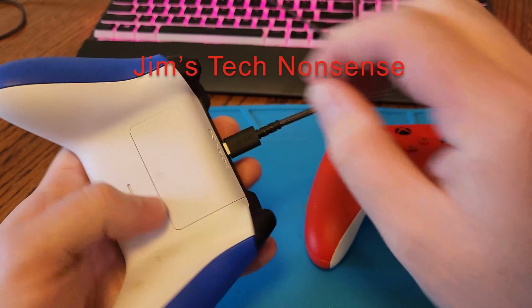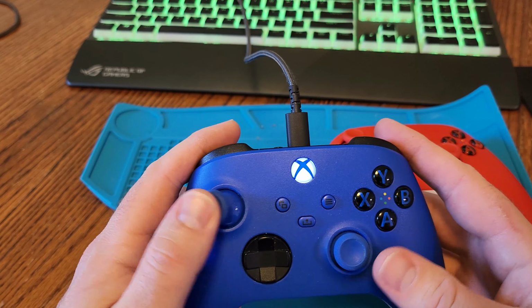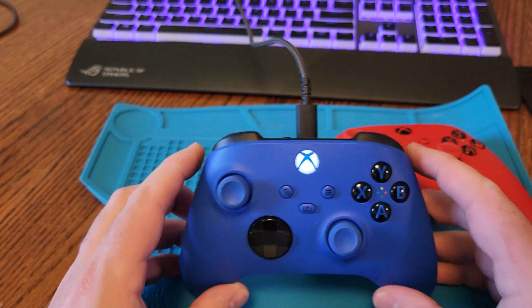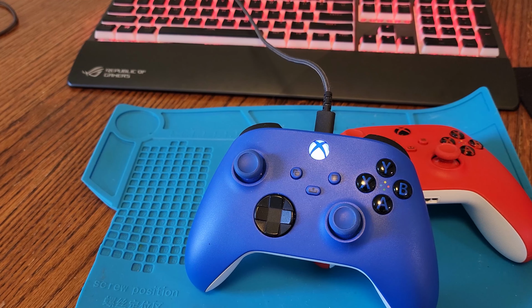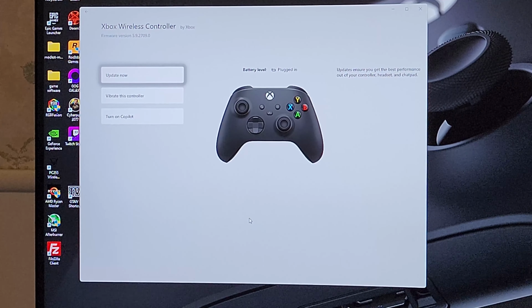Here's a video of me testing and repairing two Series X controllers. Both of them just ended up having stick drift. One was a pretty simple repair, we went ahead and cleaned it, and the other we did end up having to solder in a new potentiometer. So go ahead, have a watch, and we'll see how it goes.